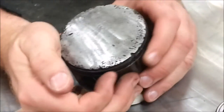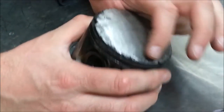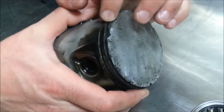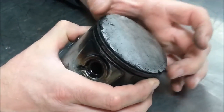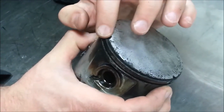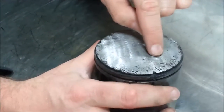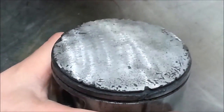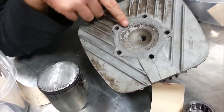You guys see this where it looks like it's got this funky pitting along the top of it, and then we got a bunch of broken parts here. The piston actually broke off between the piston top — the crown — and this ring land. This engine was overheated, getting so hot that the pistons started to break apart. The ring that was held and compressed started to help lift this off, and these pieces ended up getting smashed between the cylinder head and the piston. That's what all these little indentations are — pieces of the piston as they broke apart and mashed between the head and the piston. A matching cylinder head would have some type of indentations like that.